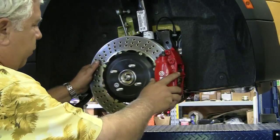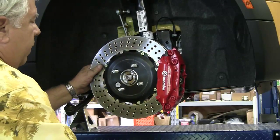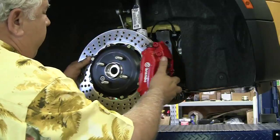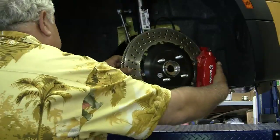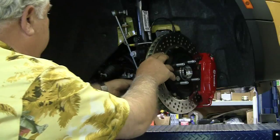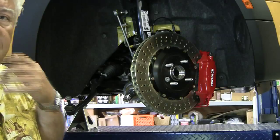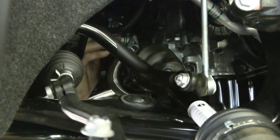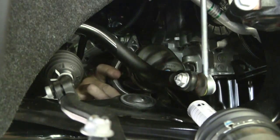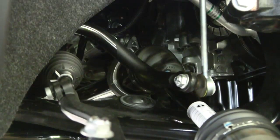Our unit's really pretty loose here. Take a little hammer and tap in this axle and we're loose on this end. Here's our drive axle - we're going to want to pull that away from the transmission. There's one upper one here - they're both 13mm, one above the shaft and one right here below the shaft. Let's take those off.